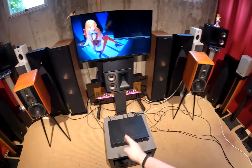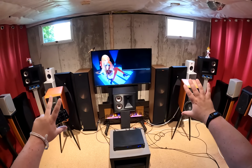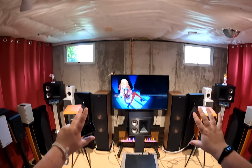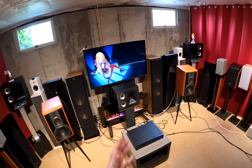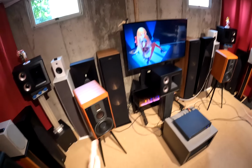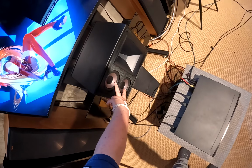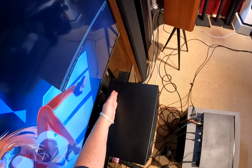That's a better design for a center channel than center channels are. All the center channels that have speaker, and either horn or speaker, little speaker, tweeter, those two speakers that are far apart, that's ruinous, because as soon as you're off axis, the distance between the two is so great, there's gonna be cancellation. When you're hardcore as fuck, you use literally just a normal speaker vertically as your center, because no matter where you are lined up, left or right, you're getting all three essentially at the same time. So this is as close as you can get to that, because you have these two, which are super prevalent, lined up, and then that one, which has this weird depth issue of that's where the tweeter's located.